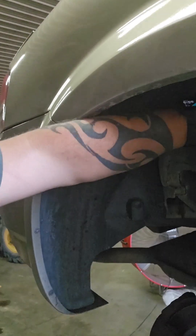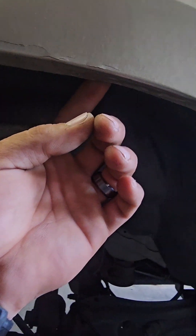As far as actually lowering your ride height — I kept the tires on in the front, don't do that. Take the tires off, it is so much easier. I had my hands in there rubbing the fender the whole time — it was a real pain. It may have looked easy at first but as the wheel came up I was having so much trouble getting it adjusted properly. Just take the tires off, that's my advice. Also I had to roll the fenders here because if not it's going to gouge into the tire.